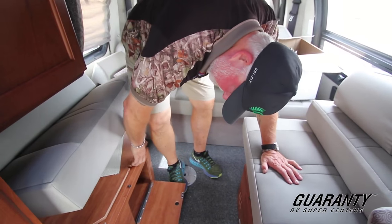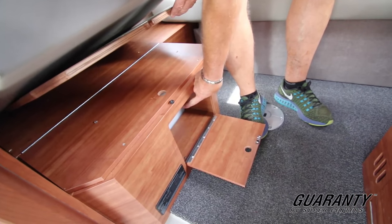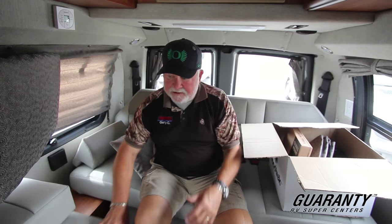There's the water tank right here. On the Chevy products for Roadtrek, they have two water tanks — they split it so there's an outside tank for running during summer and an inside tank. During winter, you drain the outside tank, run off the inside tank, and as long as you've got heat in here, you can run in really cold weather. Roadtrek is the only one I know of that has that feature.